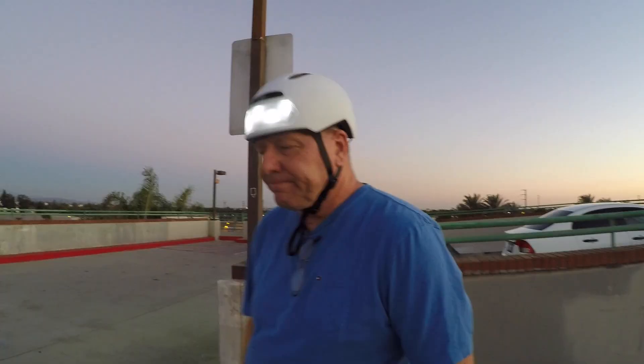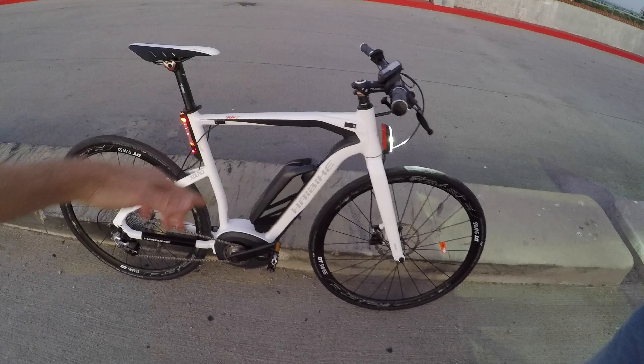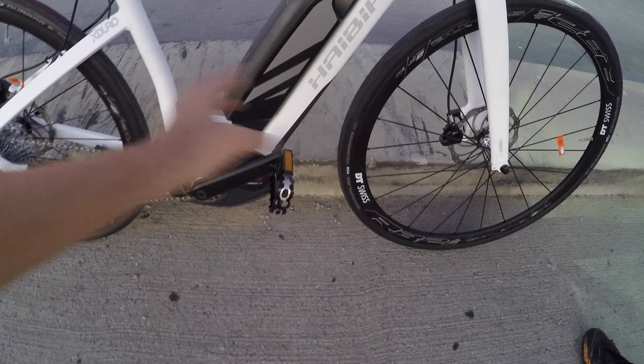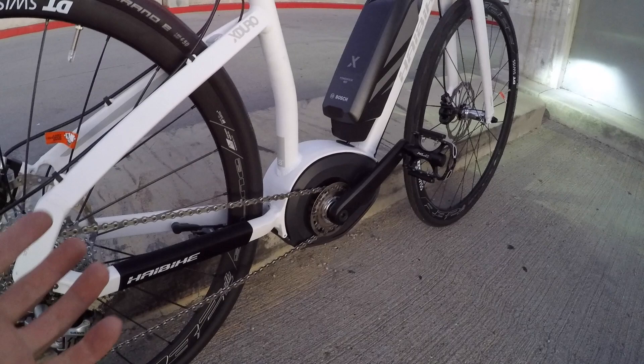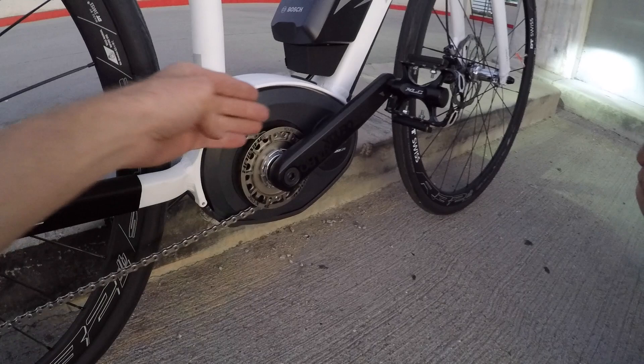All manufacturers are upping their game — it's getting better all the time. It's really responsive: when you start to pedal it instantly clicks right on. The crank arms are 175 millimeters, a little bit longer, and the sprocket spins about 2x for every revolution — so it feels like a larger traditional front chain ring. You're optimizing the motor so it spins faster and generates more torque. Electric motors like to spin at a higher RPM, and this setup enables that while staying responsive. There's also a bit of a chain guide to help keep your pants off the chain.